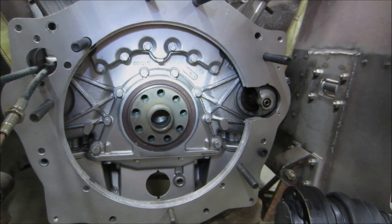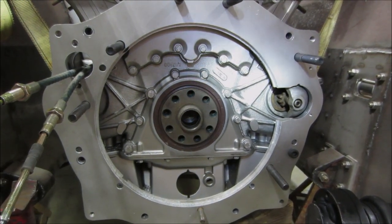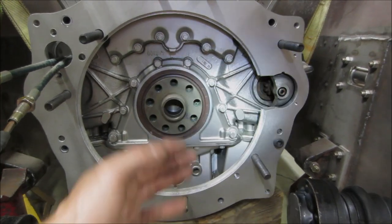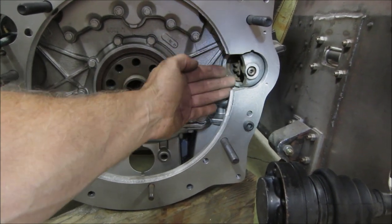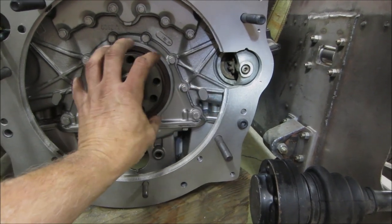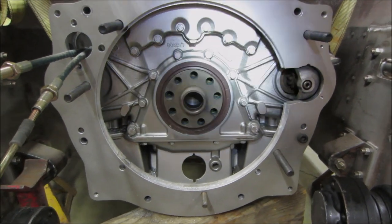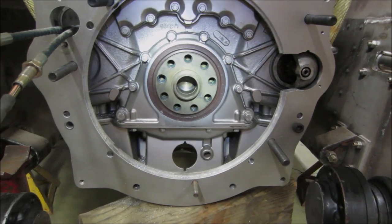Wish I had the other engine. That's probably what it was, yeah, again, the idea was stealing those parts from it. Even if it was just the flex plate, and the flex plate was going to squeeze back in here off the automatic, and then he was going to attach the flywheel to the flex plate hub. That's going to have to be pretty exact, because that thing will vibrate like crazy. But that would be the start part of it, anyway.